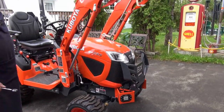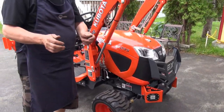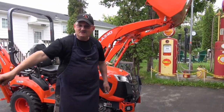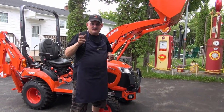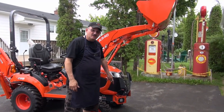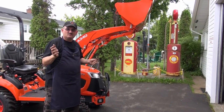When you get your ditch lights, there's going to be two holes in there. The reason why I made the pot a bit bigger too is because once you have your light in, you have to take your light out to put the bolts in. These are the things you discover when you invent things. I said, if I ever had to do this again, I would change that. So now it's changed to the point where you can put your lights in, and then you can put your carriage bolts in there as well.